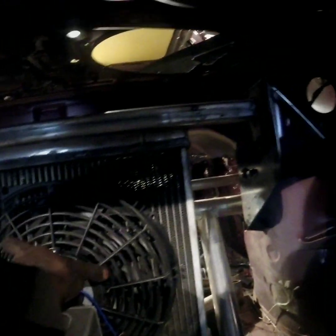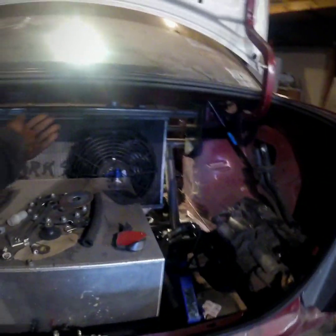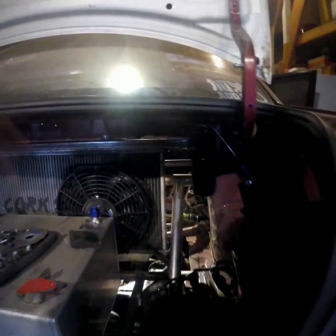The radiator is mounted in the trunk. We're using a CorkSport radiator for the time being because it is very massively thick. We're going to put two fans - one on each side - as pull fans because it'll already have air going over it. What we're going to try to do is eliminate and extract that heat out of the trunk by pulling. There's a misconception that you can use a push fan and get the same results, but I feel like with the car already going forward, I'm going to get a better result with a pull fan setup.